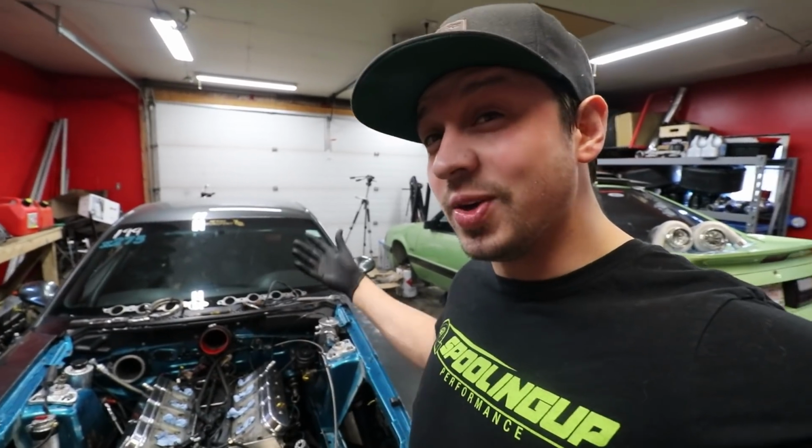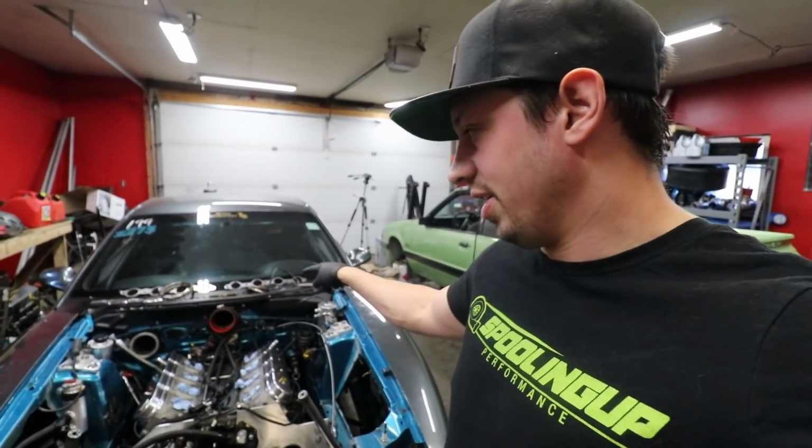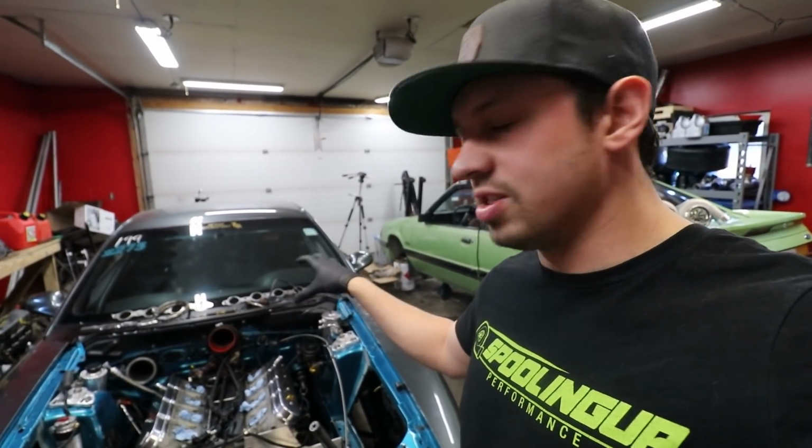And we're going to get some billet goodies put in it because if we're putting a forged engine in this and running more boost, we're definitely going to destroy the 34 element sprag in that one. So we'll get our transmission built with some better goodies inside of it, some billet parts.